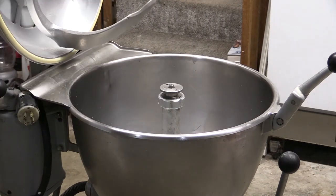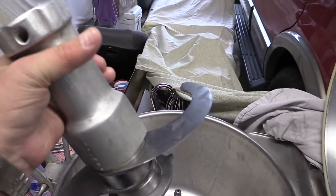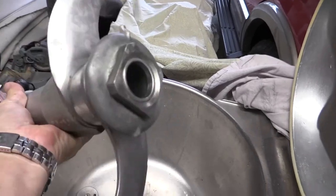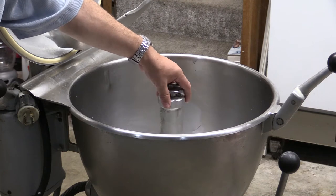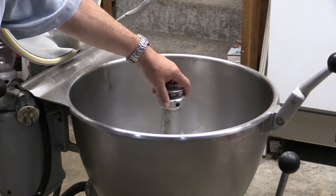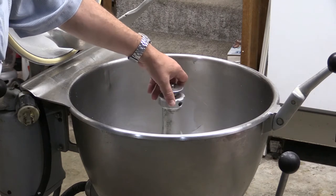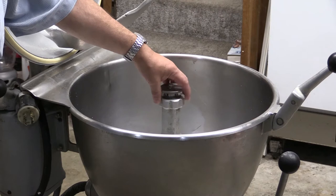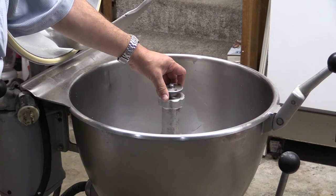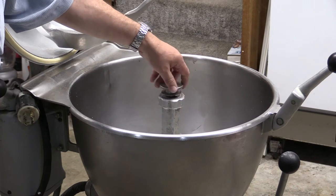These models, including the VCM40 and 25, use all metal cutters and mixing attachments, unlike the newer model versions which use some plastic attachments. Consequently, even though they are strong and very robust, if they are not properly cleaned after each use — especially when mixing fine flour-based materials — there is a very high probability that the tool will become almost permanently glued to the motor shaft, making it almost impossible to remove.